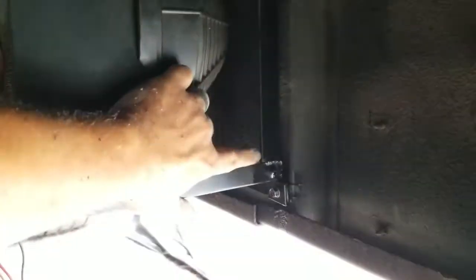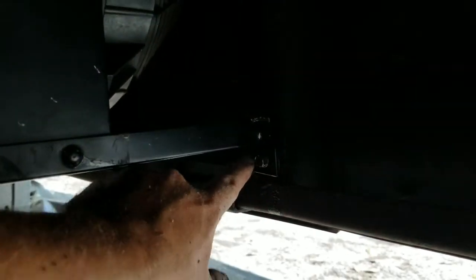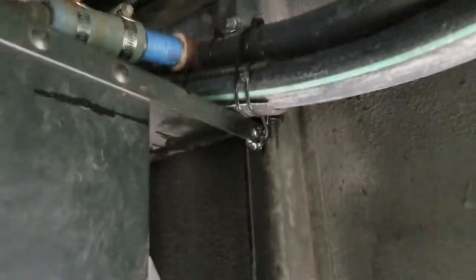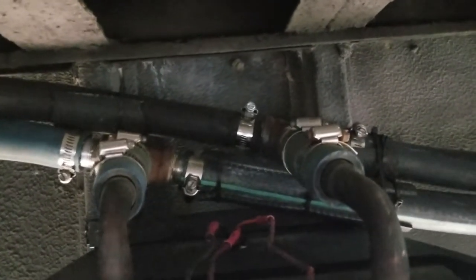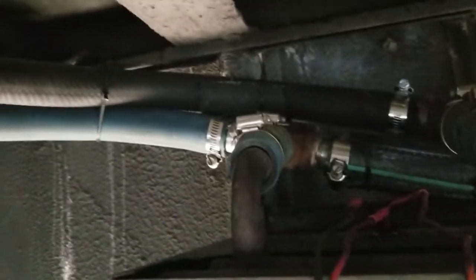So what I did is I welded some brackets for structural strength and integrity down here. I also cut some extra plating, and I screwed the heater to the actual skirt of the bus. And conveniently, the cross member, or the supports for the skirt, were exactly wide enough for this heater. And then I just ran the hoses up here to the T fittings. Ignore the wires, I still have to finish that, as stated earlier.